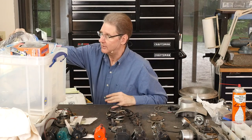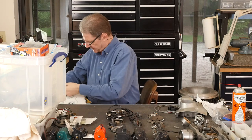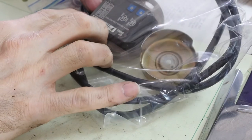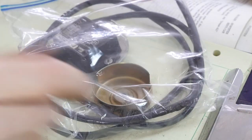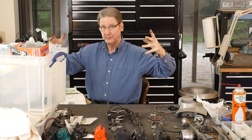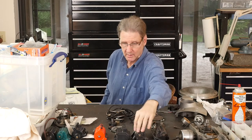This is a Crane HI4 — it's got switches to adjust stuff. It uses the same cone. It's got a single sensor here. A lot of these you can do dual fire or single fire — if you want to have two coils and individual coils. Harleys don't rev, I really don't see why you need two ignition coils, one ohm coils, and all this stuff. I've got the coils stacked here — you can maybe see them on the front camera. Stock, stock, late model stock — it's kind of boxy.